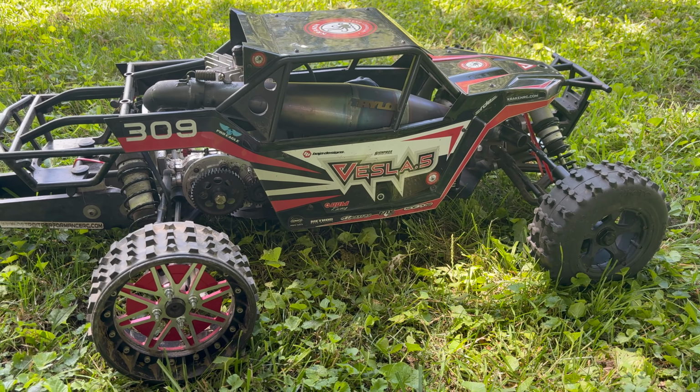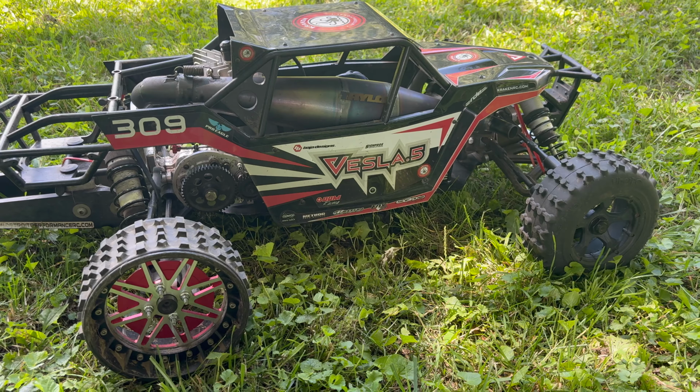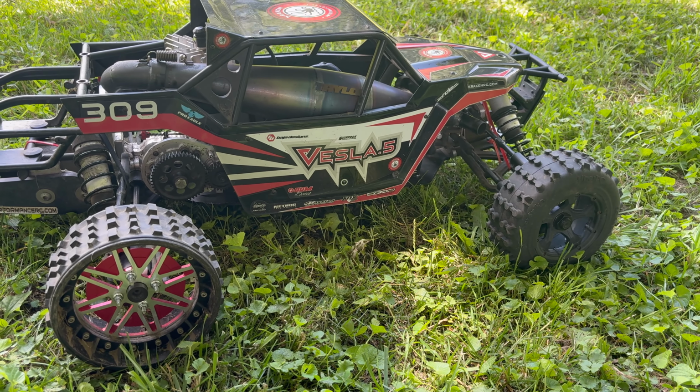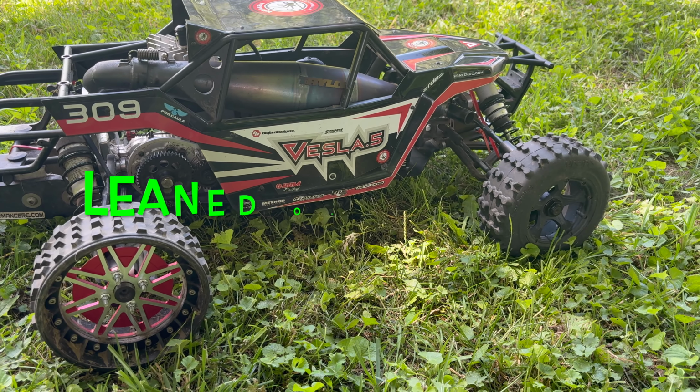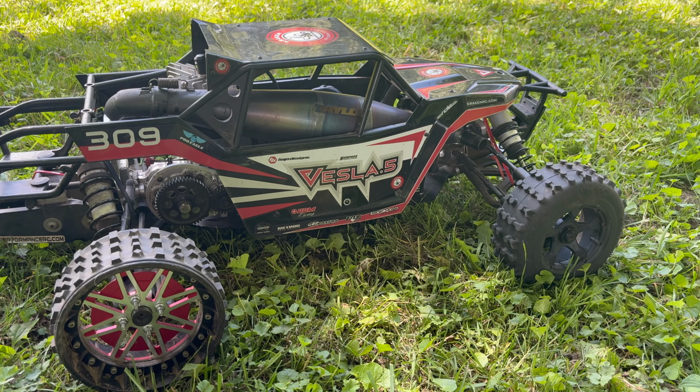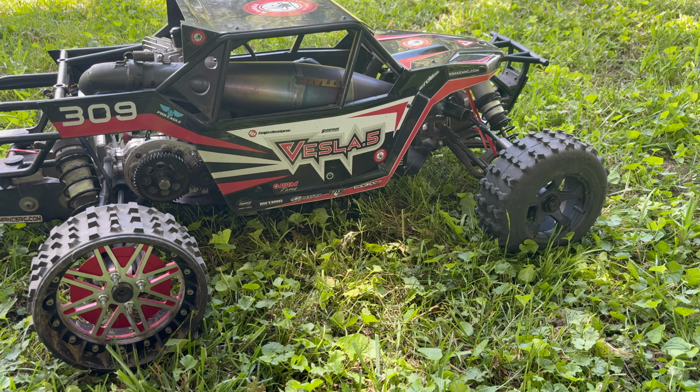That's why there's a hesitation on that transition. I was able to work it out by richening the high side yesterday, but I'm pretty sure that low side needs richening. So anyways, guys, we had a great first rip with it. Yeah, I don't know, it impressed me.